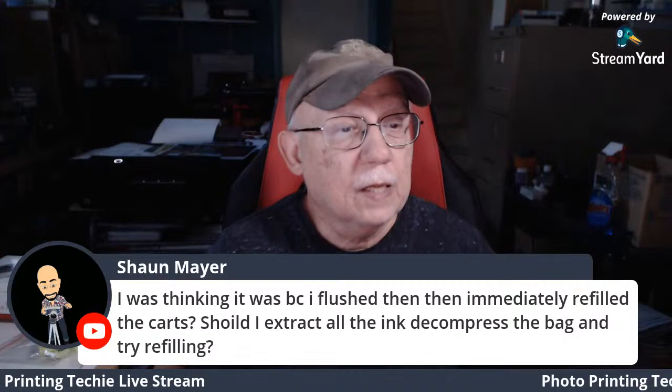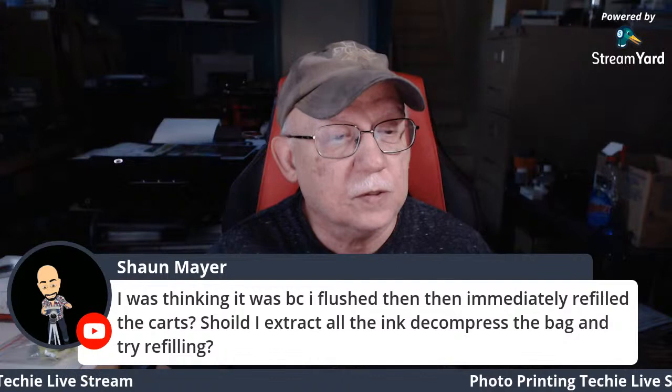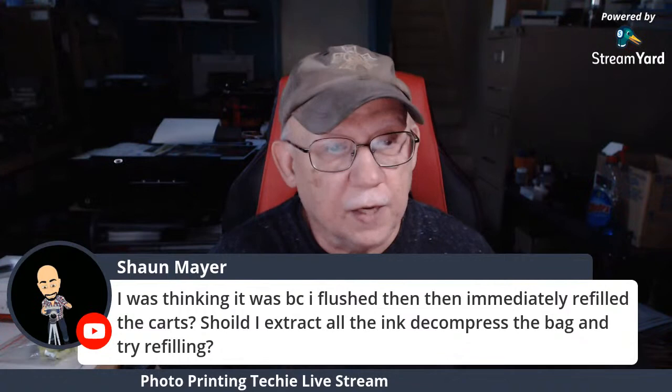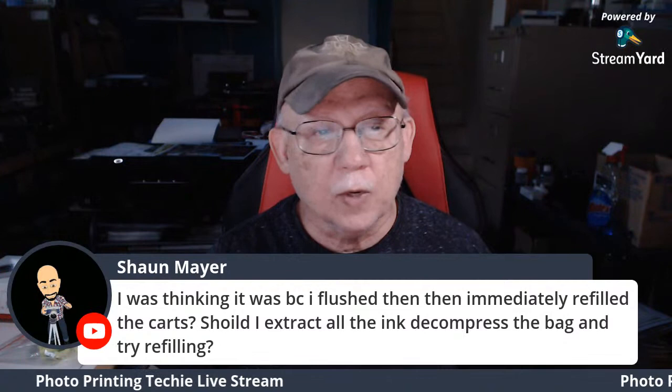Sean Meyer says, I was thinking it was BC. I flushed, then immediately refill the cartridges. Should I extract all of the ink, decompress the bag, and try? Yeah, do that. Recompress the bag, and this time just fill it. Okay, it'll take longer, but it's a little bit more controlled. You don't want to over pressurize that bag.